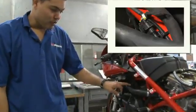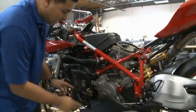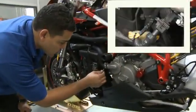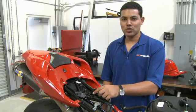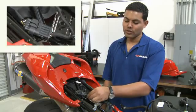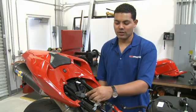On this side of the bike, you've got the front cylinder coil connector, you've got the rear cylinder coil connector, and you need the crank position which can be found right by the battery — that's this three-pin connector. In order to get switched 12-volt power, we're going to go to the stock harness tail light connector which can be found under the seat.